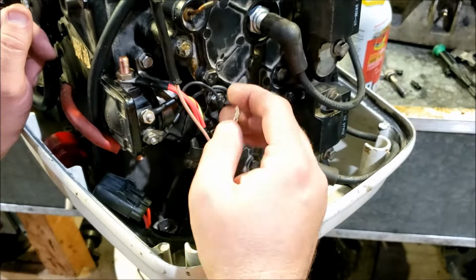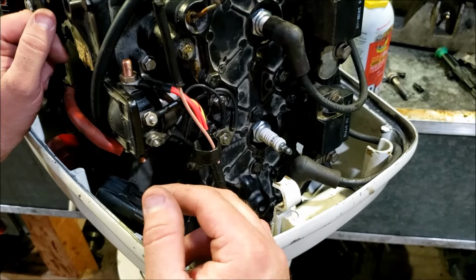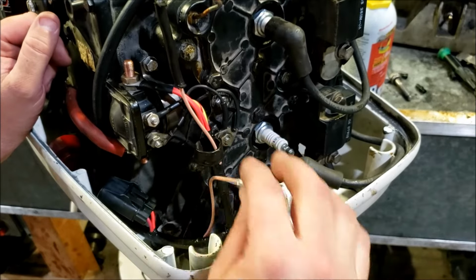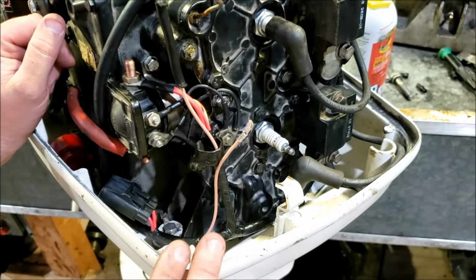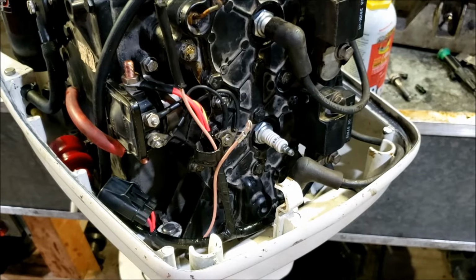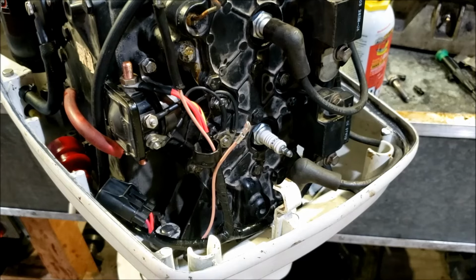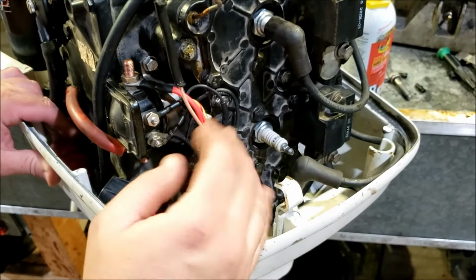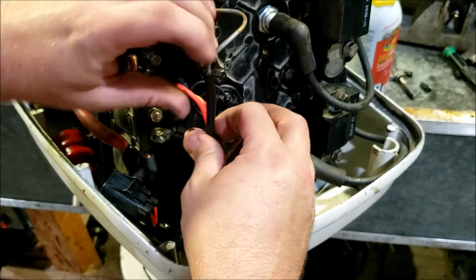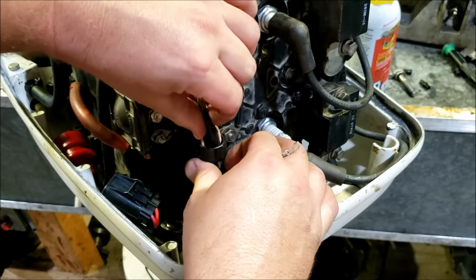So I'll do that. You should see a late 80s, early 90s 4-cylinder motor. It's got like 3 of these things hanging out of there, a couple of grounds, just wires everywhere. They don't go anywhere. It's just in case you need them on whatever application you're using it on. So don't let the extra wires alarm you. We hooked up our tan, which is our overheat alarm, which is basically what we're kind of concerned with. That is pretty important. You don't want to overheat your motor.